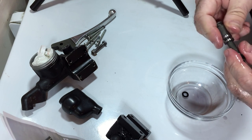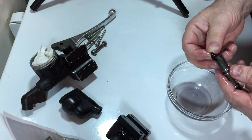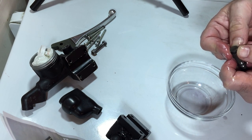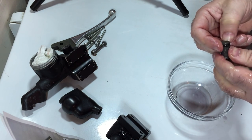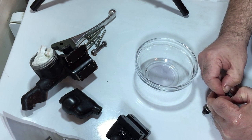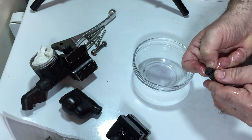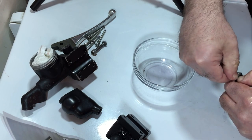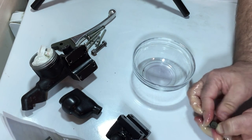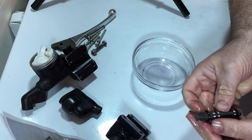That's a really nice tight fit. Moving on to the secondary washer — this was a little trickier. It's no problem getting it over that last crown of the piston, but it immediately sat in the first groove and then you've got to roll it past that groove and along the shaft of the piston into its designated groove. I needed to press down on the piston as I tried to roll it, and finally got it to lift over and roll down — it kind of rolls over itself as you push it down the shaft. It's important not to use any tools to get under there because they can easily split. Soaking for 15–20 minutes was really important.